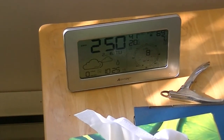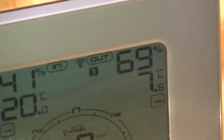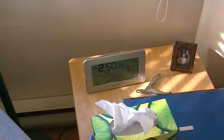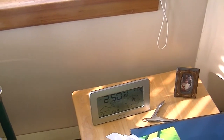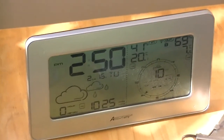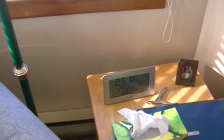That's probably for another video, but I'll tell you right now — if you ever get one of these weather stations and your remote sensor keeps going out and disappearing and dying every time it rains, the problem is they really do not like water. Even really heavy humidity can shut them down — they just seem to go into idiot mode when they get wet. My mother actually came up with the best fix: she took the sensor and threw it in a plastic bag. I did the same, my father did the same, and none of us have had problems since.